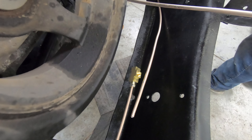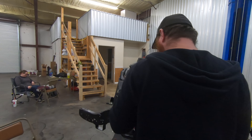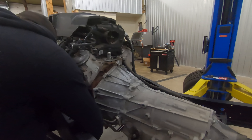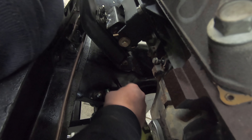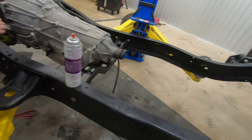Mike's getting the brake line mocked up with the junction block up front — he's got that line running all the way over to the frame where we've got this new hose coming out. Mike is drilling a hole in the cross member to put a bulkhead fitting in there for the airline, so we can continue running the airline back.